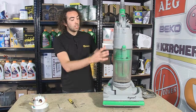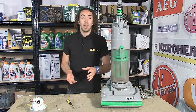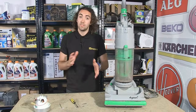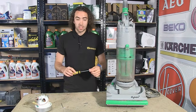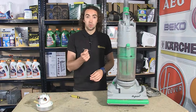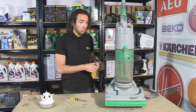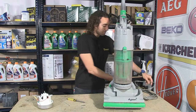In this video, I'm using a Dyson DC04, which is one of Dyson's older models, and it's very important when you're buying your new replacement motor that you make sure you get the right one for it, as there are a couple of different models available. Now, to carry out this repair, you're going to need a flathead screwdriver and a T15 Torx driver, and obviously your correct replacement motor as well.